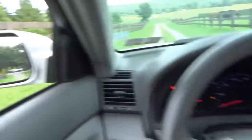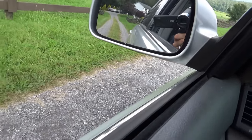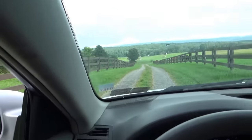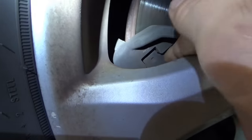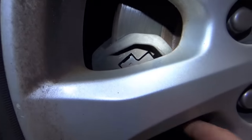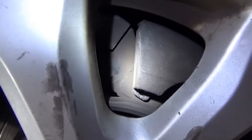I was going to take it on a test drive, but I hear this terrible metallic noise. It seems to go away when I apply the brakes, so I want to check the brakes first. Here's the noise — the front pads have no shims installed. Classic. We'll note that on the work order; not here for that. This one is also missing the shim.